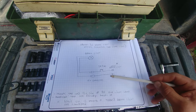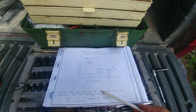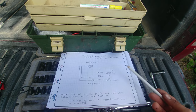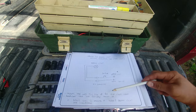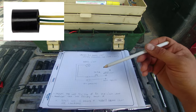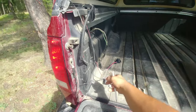Note: if you have an import vehicle, tap into the 12-volt side of the right-hand stop light lamp. For an American vehicle, tap into the factory hookup — pretty much the same thing, just pay attention to that. If you have combined turn and brake signals on one wire, you need to use a logic box, but that's another thing — you can Google how to wire a logic box, it's very simple, it just splits the signal.